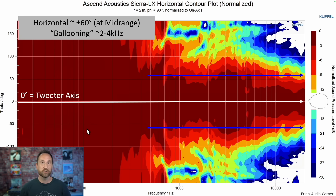Vertically, make sure that you're seated with your ears at level with the tweeter — that's how I listen to these speakers. I noticed that if I dipped down a little bit too much, or especially when I stood up — a couple of feet difference — the tonality shifted significantly. That's not atypical of a two-way bookshelf design at all, but it's just something to be aware of.